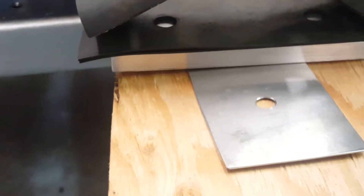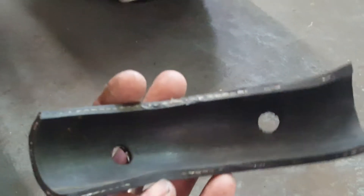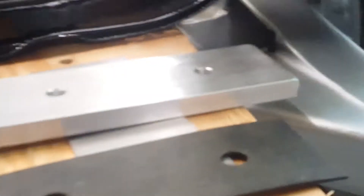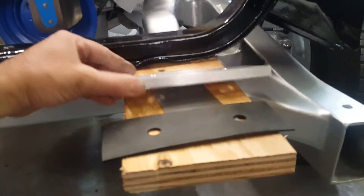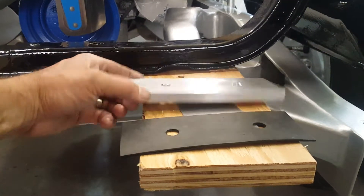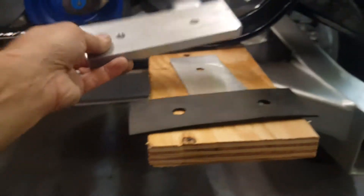For anybody that does have one of these, this is a piece of quarter-inch rubber — actually a piece of tube, because I'm out of flat stock, so I just used a piece of radiator hose this time. Two holes. And if you're asking how I got that flat — I used the shop press to flatten that out. This is my spacer, which is half-inch 6061-T6 aluminum, center-punched holes, chamfered like a machinist.